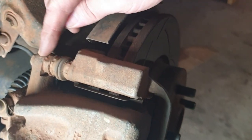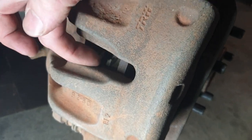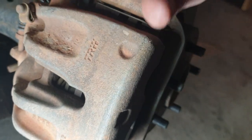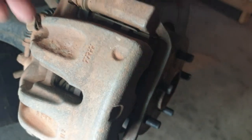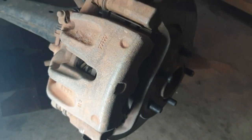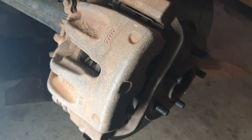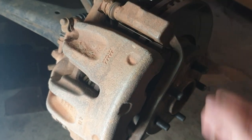Check your inner and outer pads on each corner. If there are any issues with the caliper — in particular the sliding arrangements — you're going to get more wear on the inner pads. If you've got bigger brakes with a four-piston caliper with pistons on either side, it's not such an issue. But with this style — just pistons on the inside and a sliding caliper arrangement — any issues there mean the inner pads are going to be what causes your problem first.